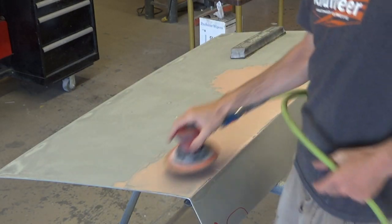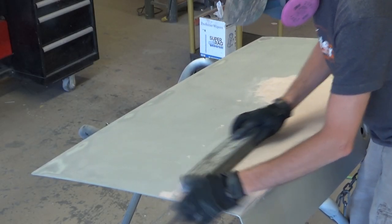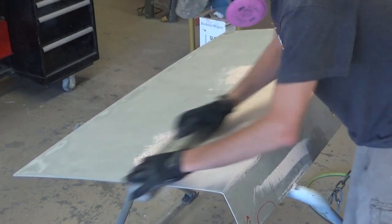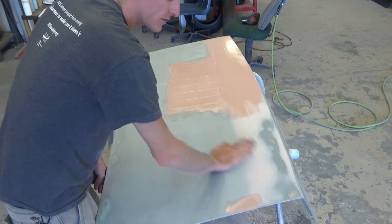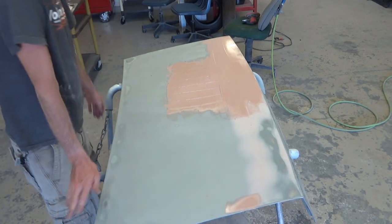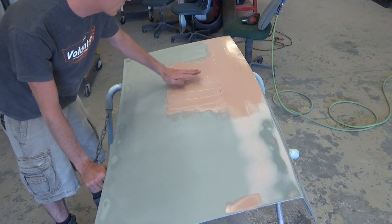Our Bondo's had a few minutes to set up. I'm just going to buzz the highs off it and then hand block it. You can see this body filler feathered really nice — it had a couple of what I call scratch marks where it didn't feather super nice, which means we need another coat. Thin and wide is kind of the idea here. I know it probably looks a foot thick on camera but it's actually really, really thin. Thin coats block nice and spread easy.